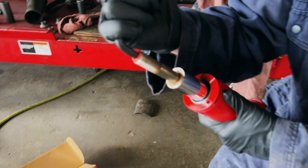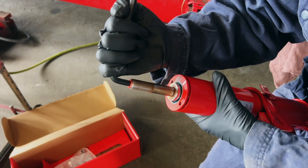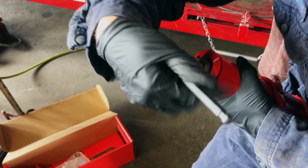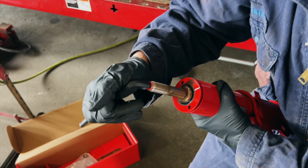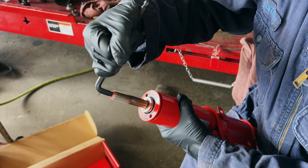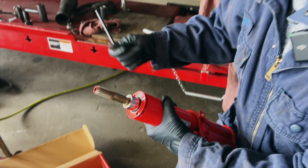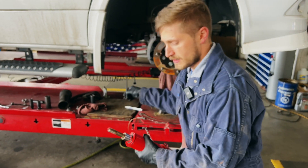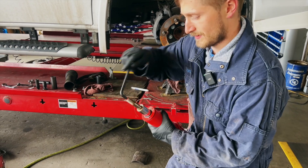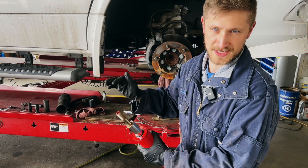As you can see, the strut has expanded, so we're going to make sure it's backed all the way off — confirmed, still backed off all the way. Now I'm going to go clockwise one full turn while maintaining pressure. All right, so now we're back where we started but we're one turn tighter — we've got our adjustment set. The shaft pops out on its own, and now you can see it's popped out of the adjuster. I can rotate this thing freely and it's not changing the adjustment at all. Your adjustment is set.